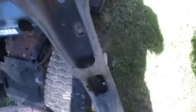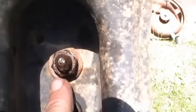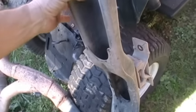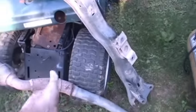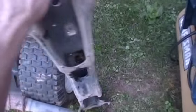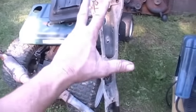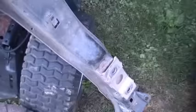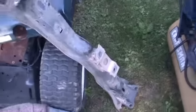The cross member is sitting out here. All the bolts came out except one on the back side. I'm going to cut this transmission mount off because this particular bolt just spins around in there. I had to take the exhaust and this out as one piece because I could not get that back bolt out of the mount. If you have this problem, this might be your only solution — just cut the exhaust and take it out as one unit.